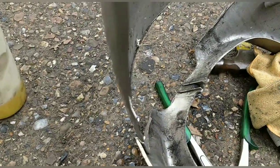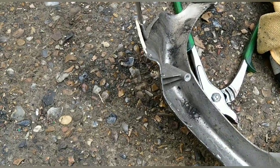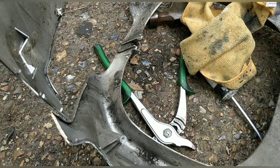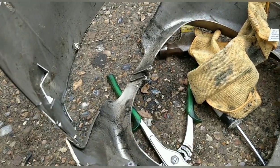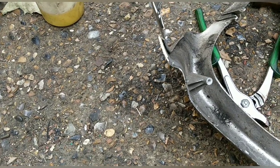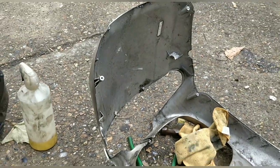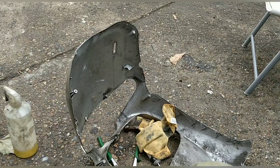I'm going to clean it with brake cleaner — cleaned it with some fuel first on the inside, then brake cleaner. Then I'll use basic super glue, probably gorilla tape on the inside, and potentially a cable tie on the bottom one because you just don't see it under there. Up here I'll probably glue some sort of brace across it to help it out. It needs to be a little bit better than it is, even though you'd get away with a basic repair on a bike this old.